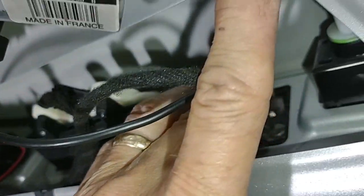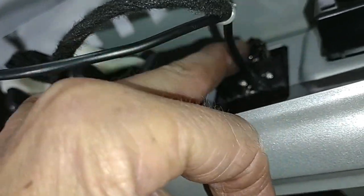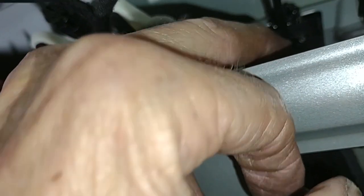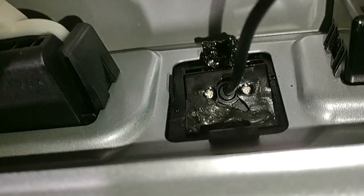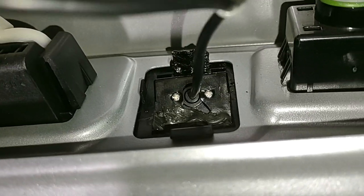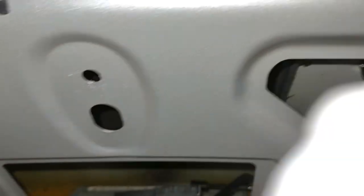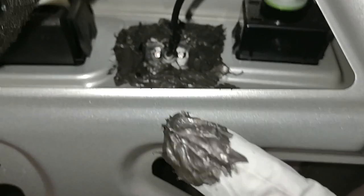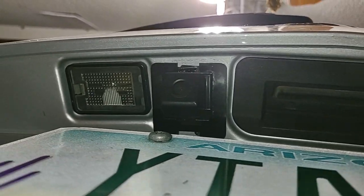I melted the sealant and pushed the camera into place as it cooled. It's now clipped in there — semi-solid. With a little more sealant around the outside to connect it permanently, it should be there for the life of the car. There's the finished job — just took a little sealant and a rubber glove. Not pretty, but there's no clue that any of that's going on from the outside. It looks just fine. Make sure it's square and straight, and then it's just a matter of buttoning it all back together.